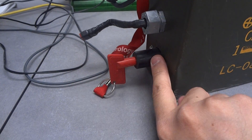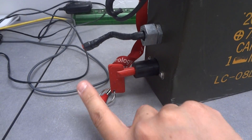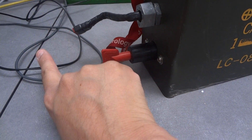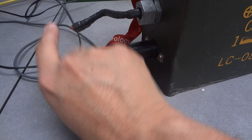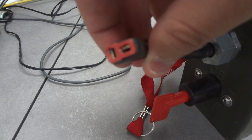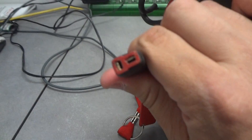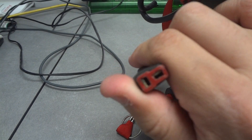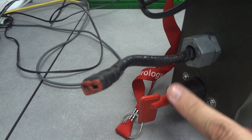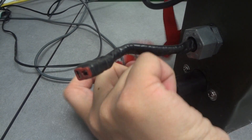So on the outside of the box there's a high amp switch — it's a 12-volt cutoff switch — and that's essentially to prevent arcing when you connect the battery into the bicycle. The type of connectors I'm using are the Deans T-plug connectors. These are RC-type connectors; they handle a lot of current discharge and they're very reliable.